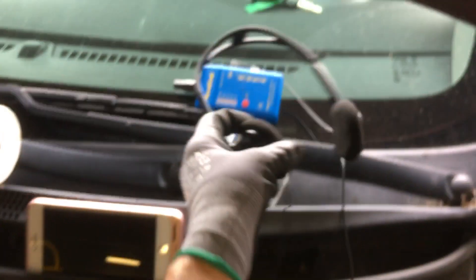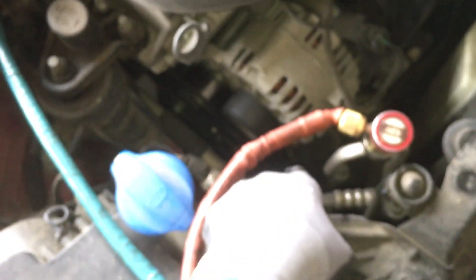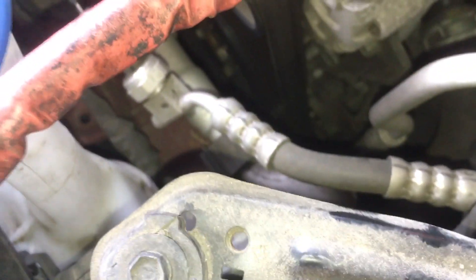Let me take this off and I'm going to drain the nitrogen out of here - it's refrigerant time. Actually, I'm going to try the bubble method first and see if I can hit anything. I'm suspecting the shaft seal on this unit. I'll hit the bubbles around the seals of the O-rings around the hoses, but we might have a shaft seal. There's no evidence of oil or dye coming out anywhere, so let's wait for the next video and see what happens.